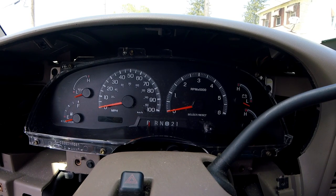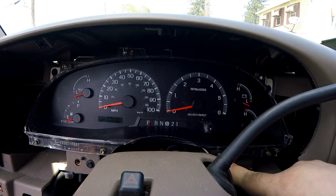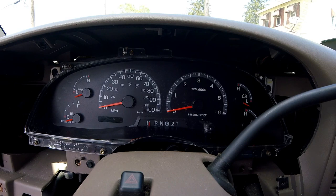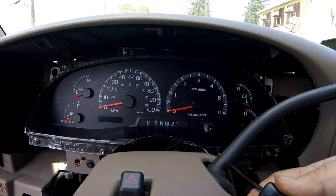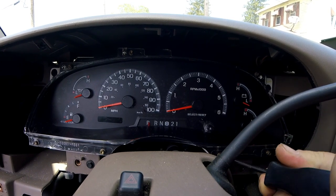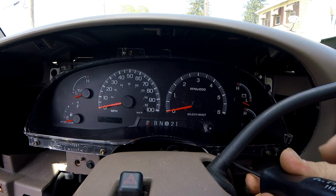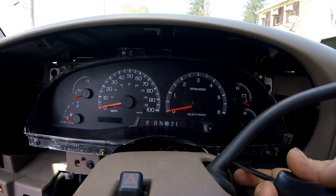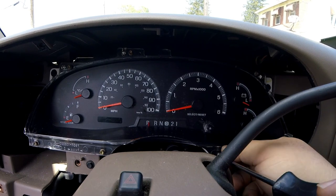Like I said earlier, I suggest taking these little bolts out for the lens. It's a T15 - luckily I have a driver so that's a good helping hand. You might be thinking, well why can't you just move it out? Trust me, there's no room. You'd end up having to take off the top part of the dash, then the radio, everything.